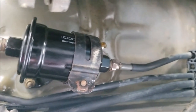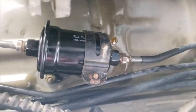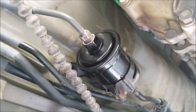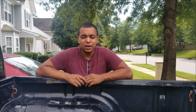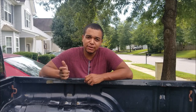The bracket is back in place and both sides are secured. Now all we have to do is check for leaks. I'll reinstall the battery negative terminal, start the car, and check for leaks. Fuel filter change is complete — I've checked for leaks and we're all good. Quick note: it may be difficult to start your car after this repair. Just turn your key from on to off a few times to prime the fuel pump and get fuel flow back to your engine. After that, your car should start fine.